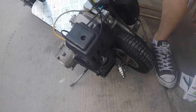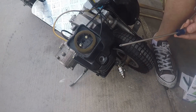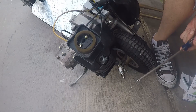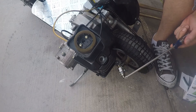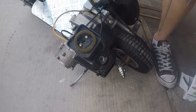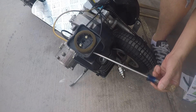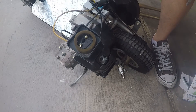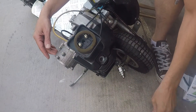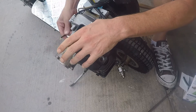What's up YouTube, today I'm gonna show you guys how to change a carburetor on any kind of lawn equipment — like a weed whacker, a trimmer, a blower — any engine. This is usually the problem why they won't start after a while. Before we take this off, let's pull off these gas lines.